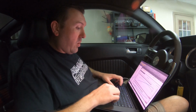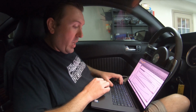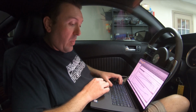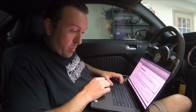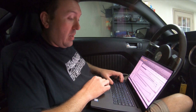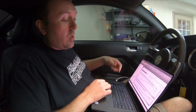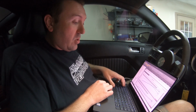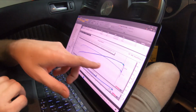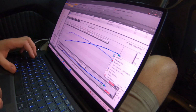So we've got the dyno graphs up here, and the 2.8 liter pretty consistently makes about half a pound, even a pound more boost than the Gen3R, given the same pulley size. And it is a little bit larger. It does displace a little bit more air with every single revolution. And with that air, it uses it pretty darn similarly to the VMP Gen3R.